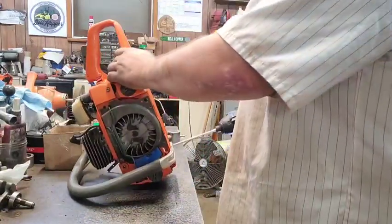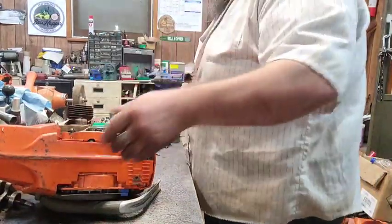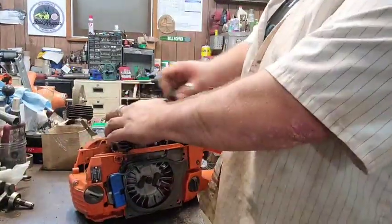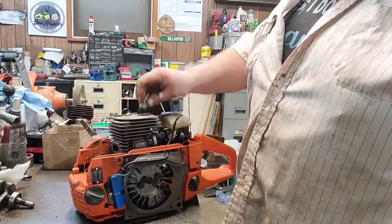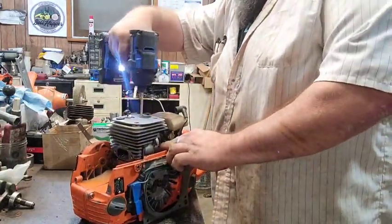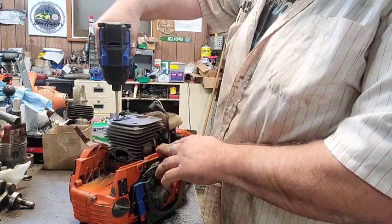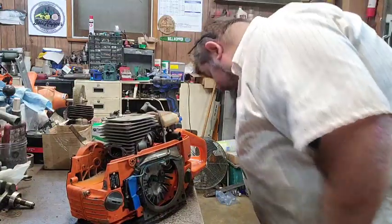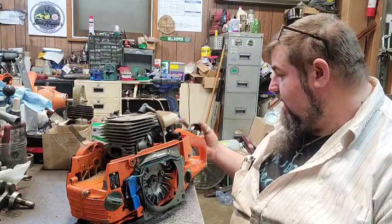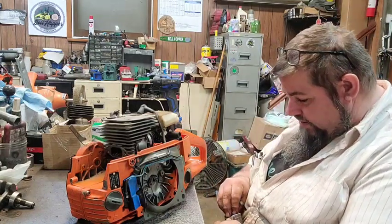I was thinking about something, and I was looking at it, and I may not use the dominant piston in here because the timing numbers on that piston are a lot greater than what they need to be. Because I've got the edge of it cut down, the timing's advanced a lot on it. I actually need to retard the flywheel timing on this, put this piston in. Because I think that's part of it.